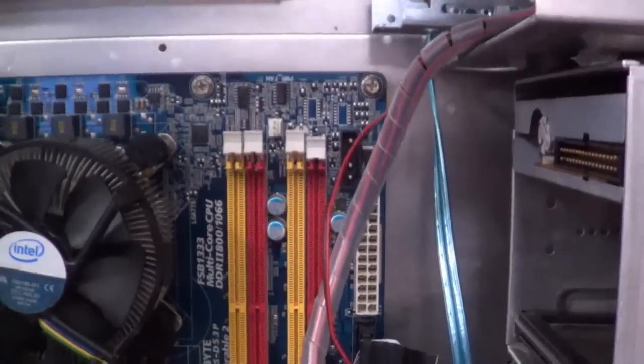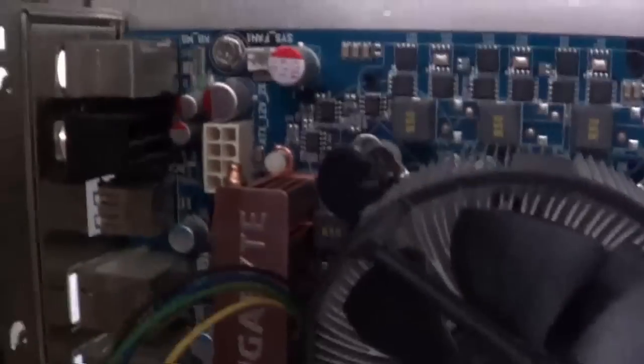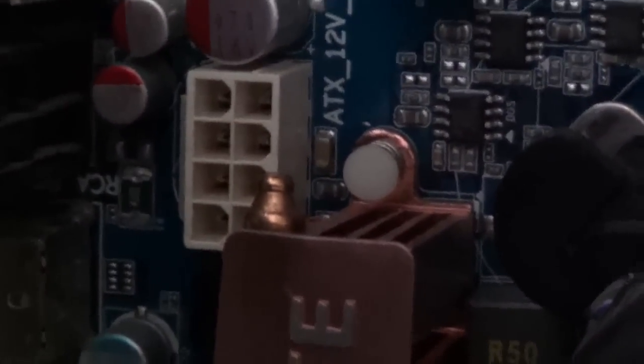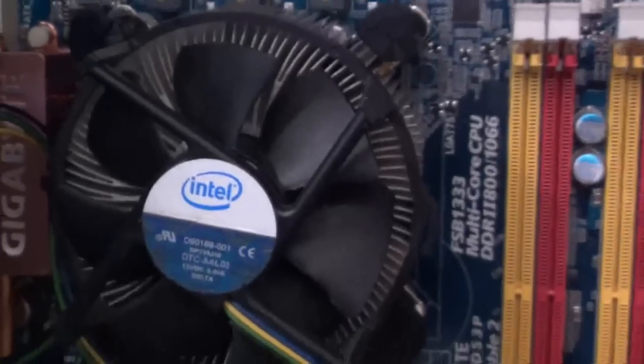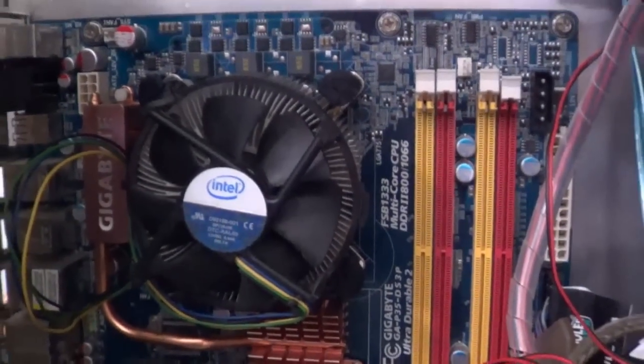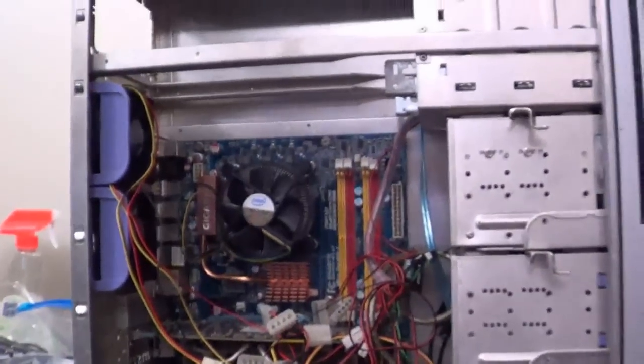Some people, given recent events, may think that I killed this system on purpose, because I took the safety cover off the 4 8-pin something or another there and attached an 8-pin auxiliary connector where there traditionally was only 4. Of course, there's 2 12-volt connectors there, and that's when I started getting the postcode for the motherboard not being any good. So, that's partially true.